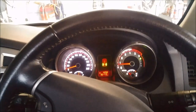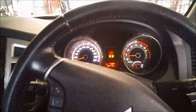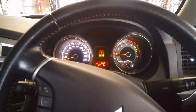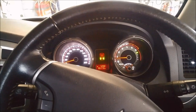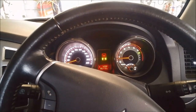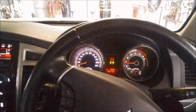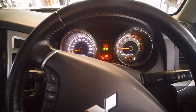It's taken a while to get up to 40 degrees, so I'm just going to take it for a run. I've overfilled it slightly, so I'm expecting to let a little bit out as it warms up — the oil will expand. It was just trickling out at about 25 degrees with the motor running, so I'll go for a bit of a run and recheck it.